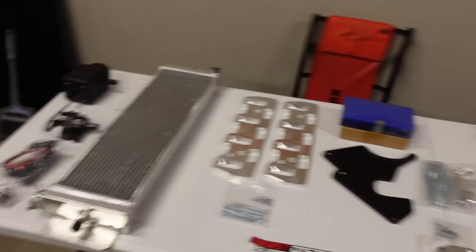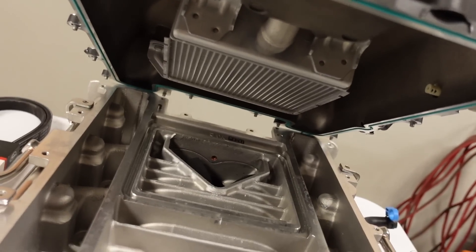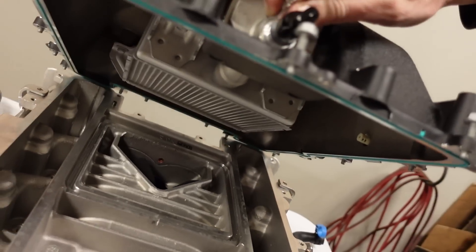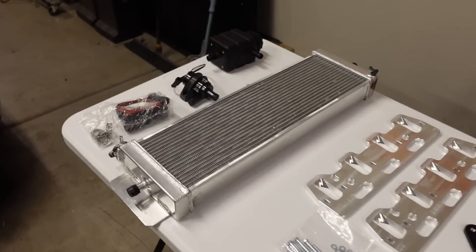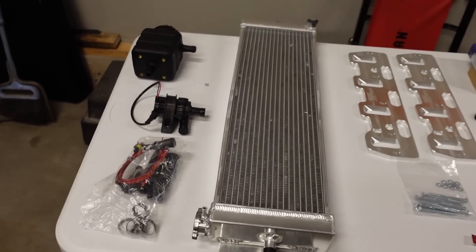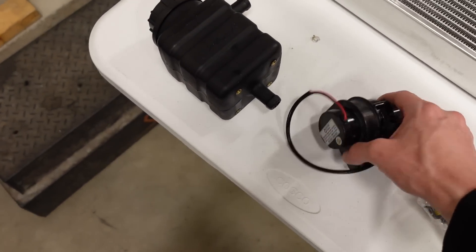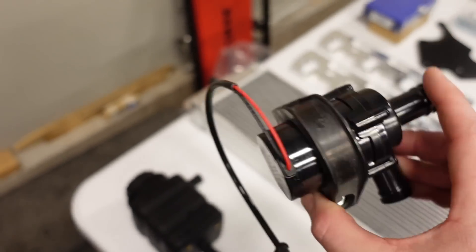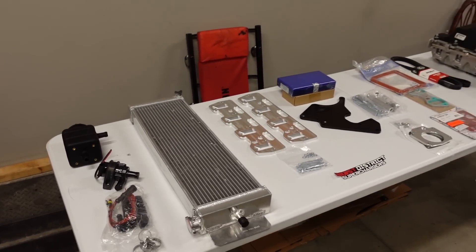We have the stuff for the heat exchanger — on the bottom side of the lid you can see the heat exchanger in there. Air enters from the supercharger and passes through the heat exchanger to be cooled off. Liquid gets pumped through these fittings and goes through a low-temp radiator installed in the front of the truck. This is their upgraded heat exchanger — it's a little big, but we'll get creative mounting it up in the grille. We've also got the reservoir and the fluid pump, which is rated at 23 liters per minute, plus a wiring harness for it.